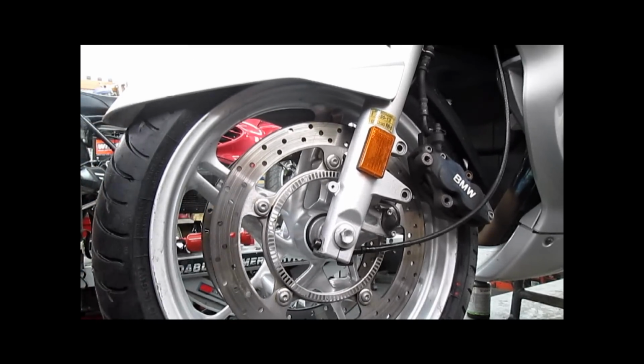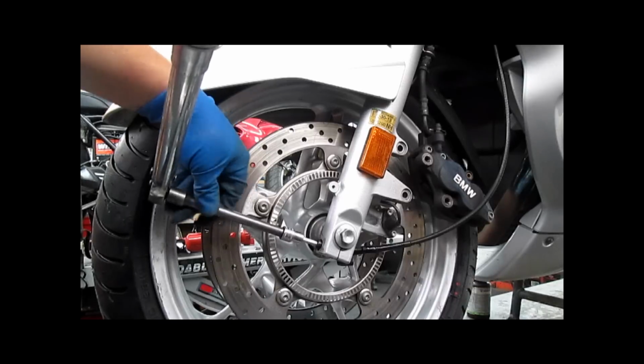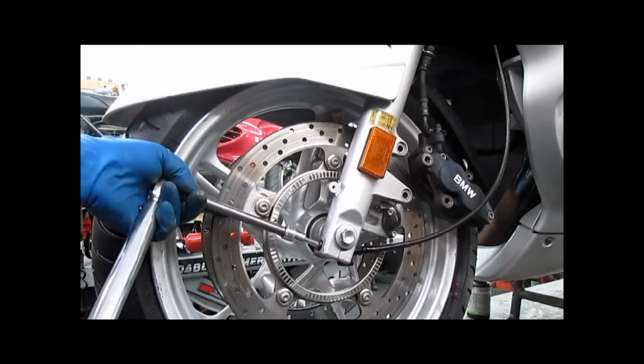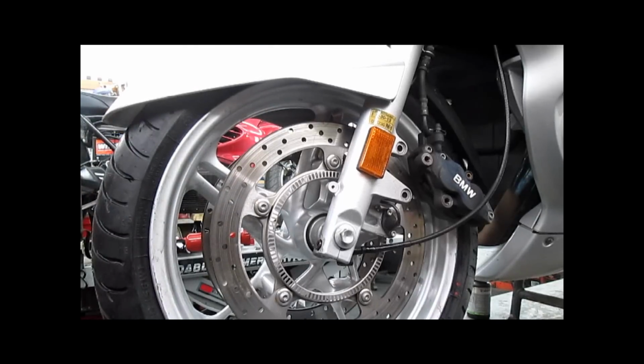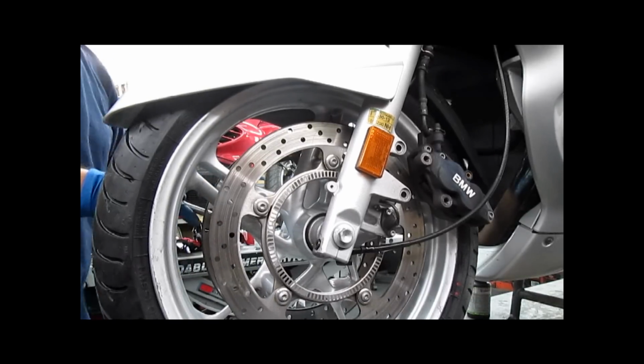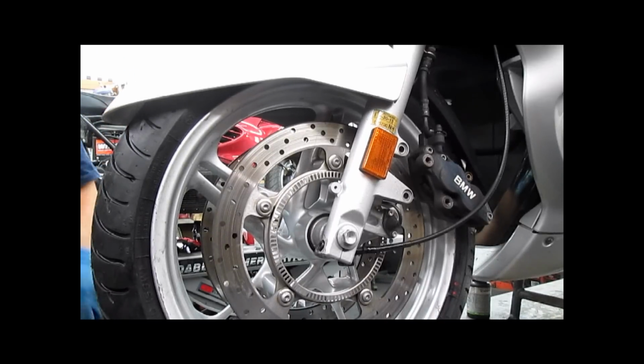That's all there is. There isn't much. It's not a lot of torque. We're going to drop the torque wrench back to 20 Newton meters, which is the minimum on this one, but also coincides with the torque of the pinch bolts. We're going to torque that pinch bolt to 20 Newton meters, and then do the same on the other side. We can now remove the drift because the axle is secured from rotating. That's those.